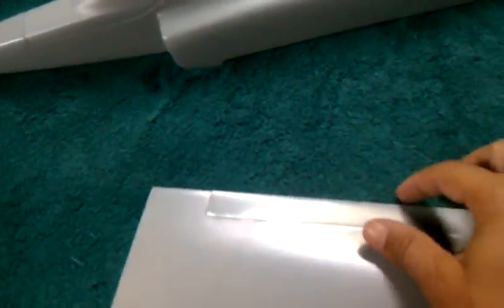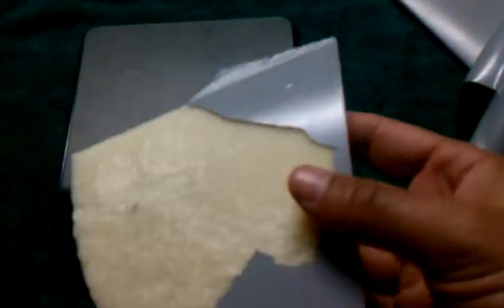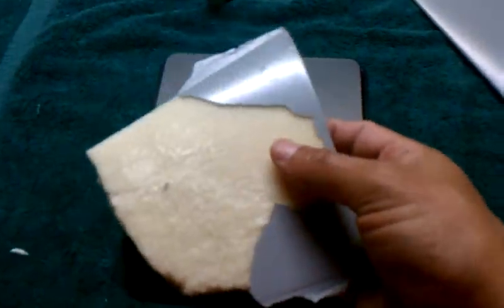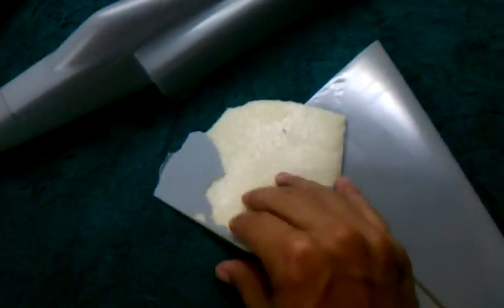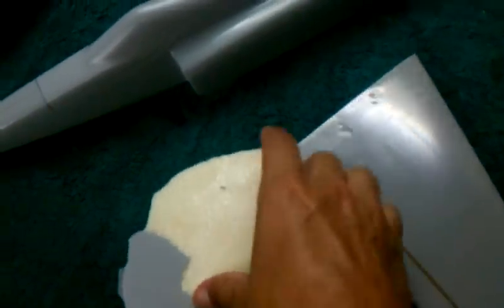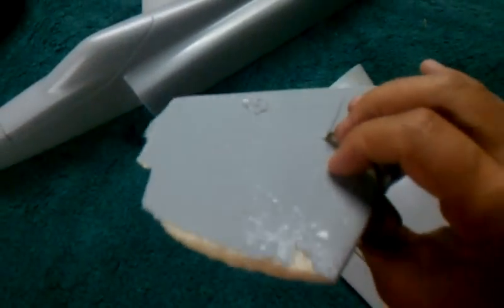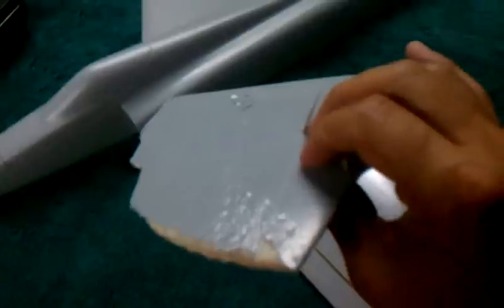The wing's very encouraging. The hinge works great. Here you can see I've done a couple different wings. This wing was an attempt to do no fiberglass on the skin and just primer. It delaminated in places, and other places it bonded, but lots of imperfections. As much as I like the concept of no glass, I'm not sure that it's going to work.